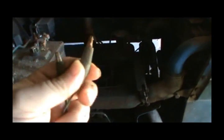So back with you — if you've got a piece of wire with alligator clips, it makes this job a lot easier. All we've got to do is plug this one back up — we don't need it — we just need to flash that one. We figure out which one's the positive, which is this terminal. Put the alligator clip on it, get it on there, and then just touch it to this guy. And it should spark — you see it sparked. We'll plug him back up.